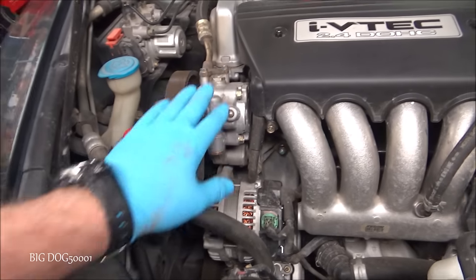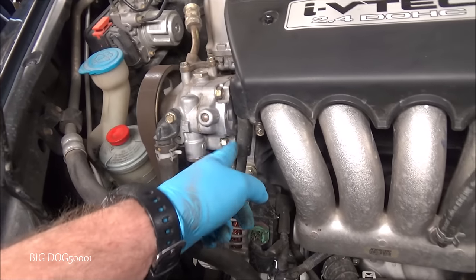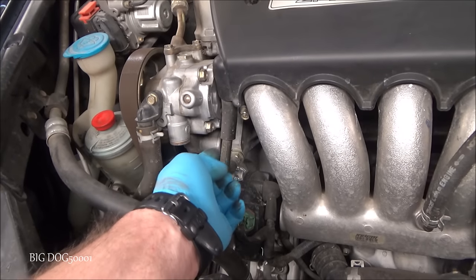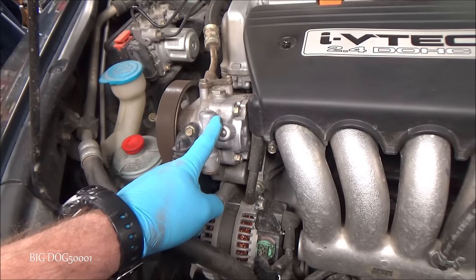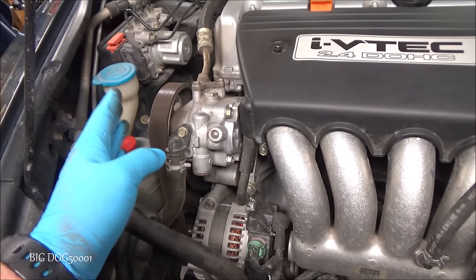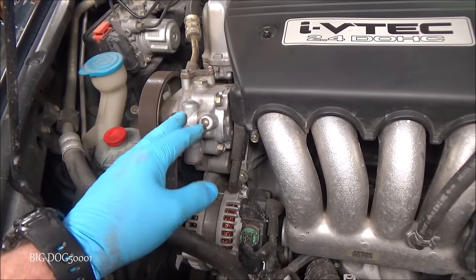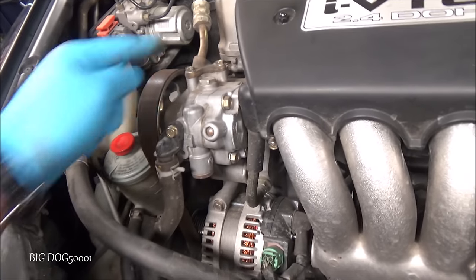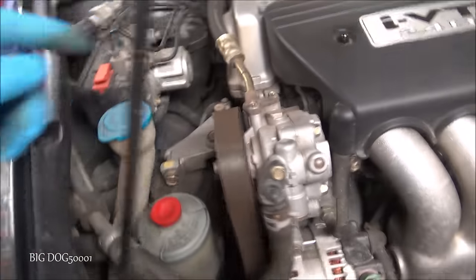This is your power steering pump right here on these older systems. A lot of times they'll leak out of the internal seals — you'll see it seeping out of the sides. I've had to rebuild these, especially older ones, but it seems common across all models. Eventually those seals get hard as a rock and you have to tear it apart and replace them. There are also o-rings inside these fittings, especially the feed line, so we want to make sure we don't see any fluid anywhere. You can see this is all bone dry — nothing here.